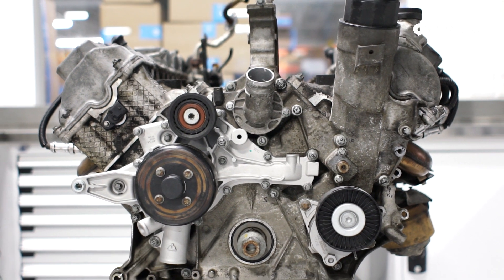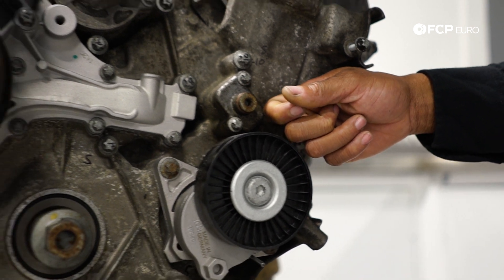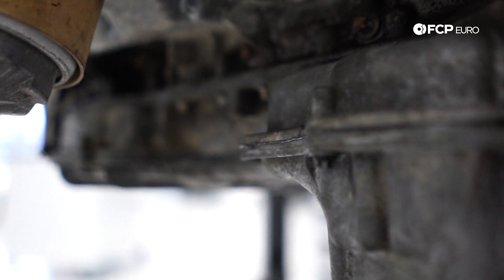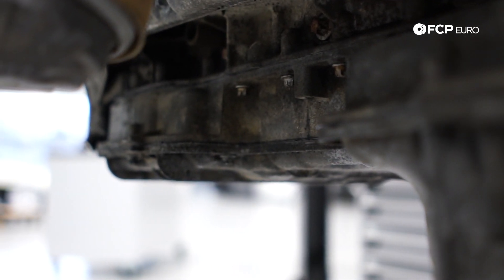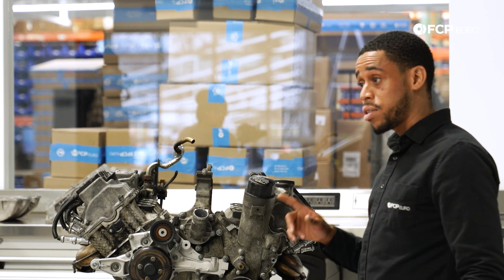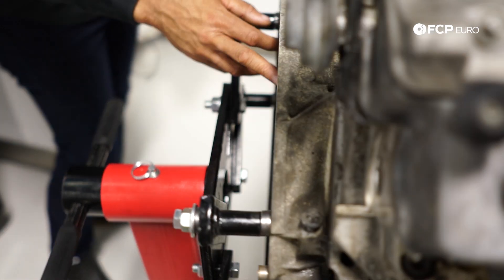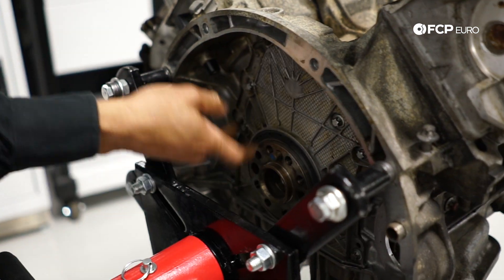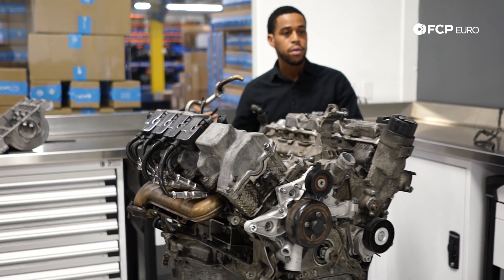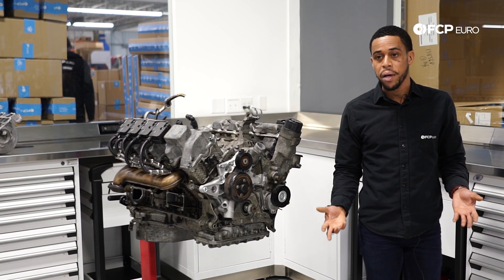Moving to the front of the engine, there's a seal poured on the timing cover that can also leak oil. If your engine is equipped with an oil cooler, that's prone to leaking as well. Check out the oil pans — they're sealed with RTV sealant and can leak. Also don't neglect the rear main seal: a very common leak in a not-very-accessible location. If you're noticing oil on the floor towards the area between the engine and the transmission, it's going to be your rear main seal.